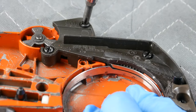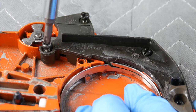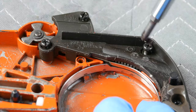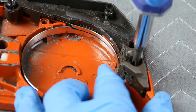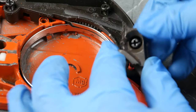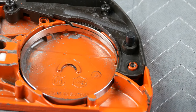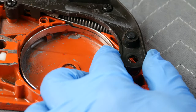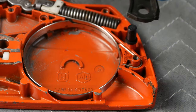Although this next step is unnecessary to resetting the brake, it's necessary to show you how it works. If you decide to remove this chain brake cover, be sure and have your safety glasses in place and respect the underlying spring that's under high tension. Note this black rubber heel that must first be removed. This steel band wraps around the clutch drum, and if you look closely you can see one end of it is attached all the way at the top left of the spring assembly.